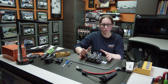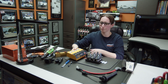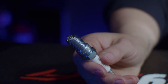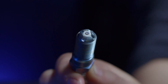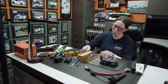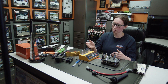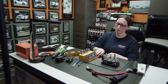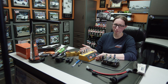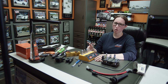When it comes to choosing the right spark plug for various applications, I'm going to do a neat sample demonstration. I have a spark plug tester machine here and I'm going to pick a few different spark plugs with different heat ranges, gaps, and protruded versus non-protruded — including a new style that doesn't have a ground strap per se. We'll turn the machine on, run it through its RPM range, and you can see the different sparks. This is a typical idle at 700 RPM; a bigger cam race-style car will go to 1200. Now we'll go all the way up through the RPM range to 7000.